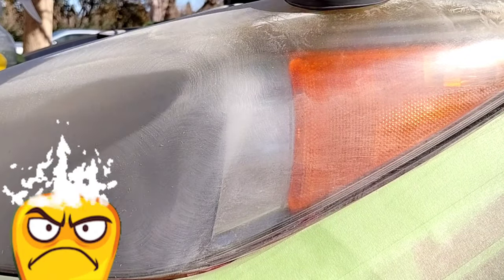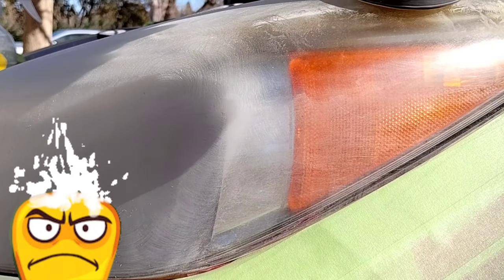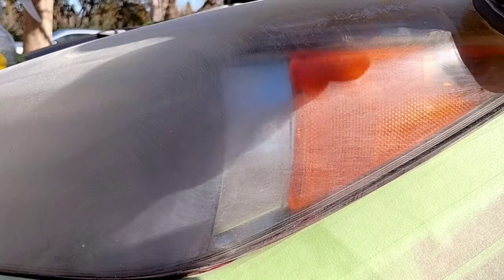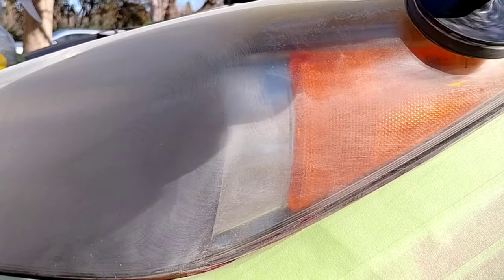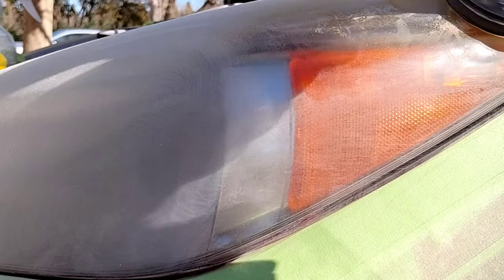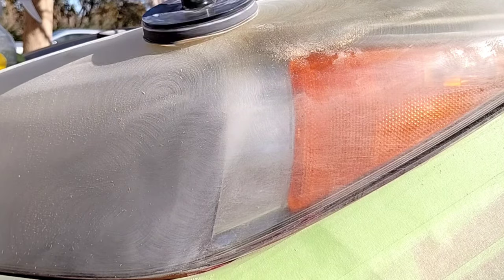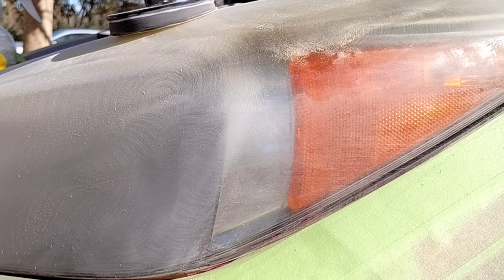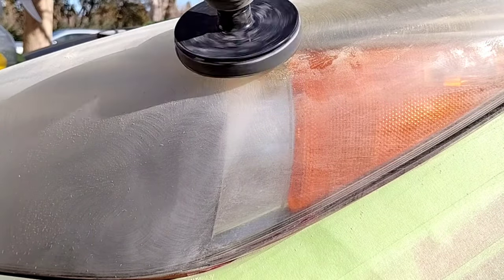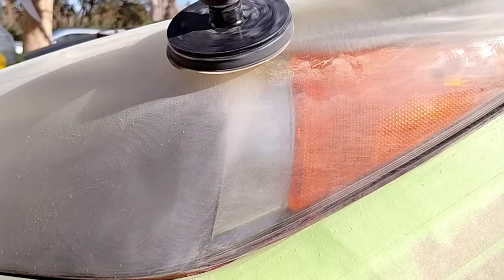There's no other way around it. You don't want to try to nitpick. It's always better to remove the whole thing, let it dry, and start over. Because once you start trying to spot-change things, you're never going to get the proper finish on the headlight. There's always going to be some kind of defect or something weird looking about it. You want it to form that nice, pretty shell that's uniform, even, and leveled out.